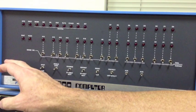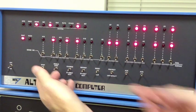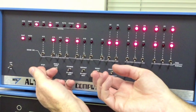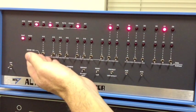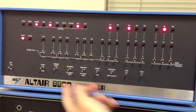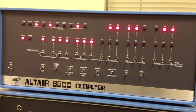Let's go ahead and turn this computer on. In order to make things even quicker today, we are using the multi-boot loader provided by MITS. It's a ROM that saves you from having to enter bootstrap loaders on the front panel, and this has been demonstrated in some of our other videos as well. Let's give the machine a hard reset. The address of the multi-boot loader is at 177000.